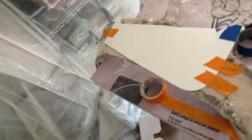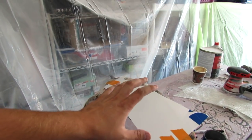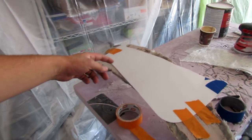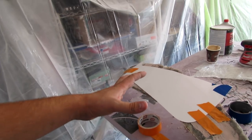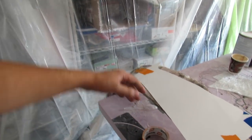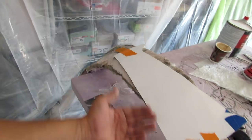This foam flare that we made originally is so useful because it's so great for just getting the general curve. I cut out 2 sheets, that's all I'm gonna do, just so it'll still be super thin and flexible. And that means that if we do need to curve it more, we can. Because if you add too much, it makes it really hard. When the fiberglass forms to a curve, it usually stays in that. It's still flexible, it has give, but it always tries to return to the form, is my point. So 2 sheets for now, then we'll make sure the curve is correct, because I know at some point there's supposed to be more of a curve than normal. It's weird, but then we'll lay this part flat and start to build up the fiberglass for the edge, and that'll basically cast its permanent shape. Same thing as the flares, just a much smaller piece.